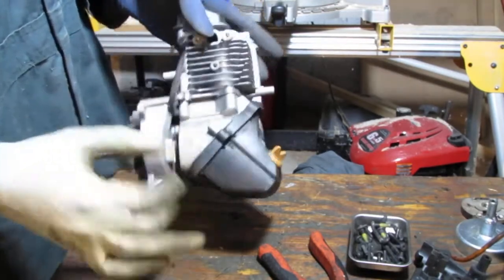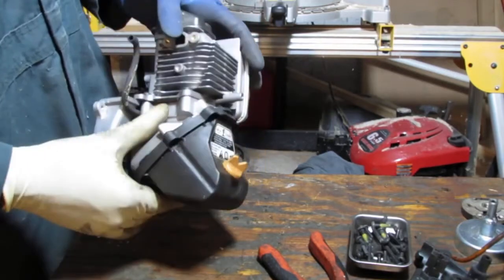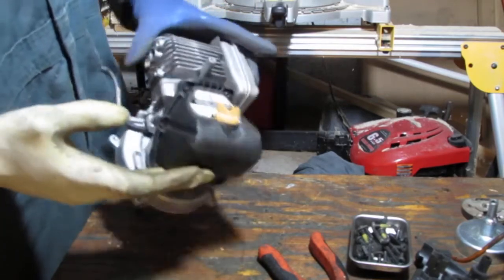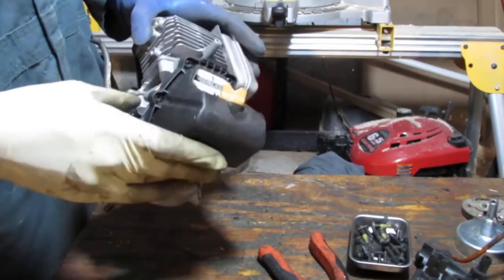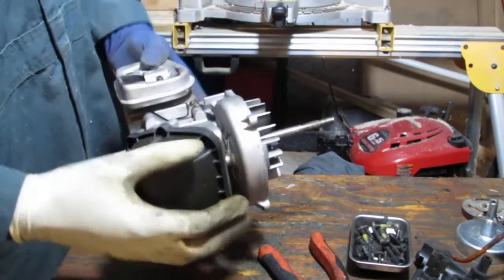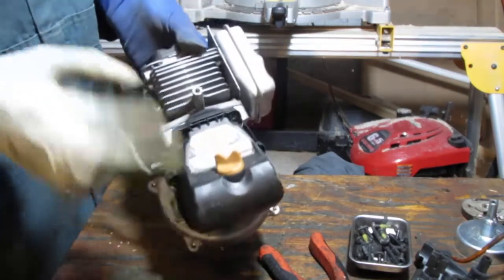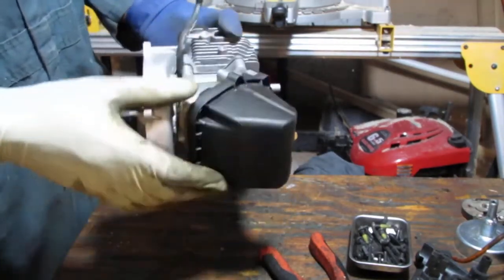Remember? Doesn't look like it. This engine looks like it's in really good condition. And the oil leak I'm seeing is just sloppy pores, and it leaked up in there. And that's about it. The seal here is pretty good. There's no leakage whatsoever in the halves of this engine. So this gasket's in really good condition right here.